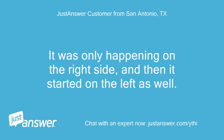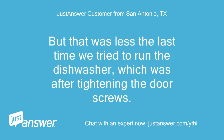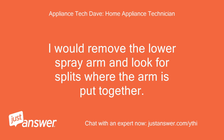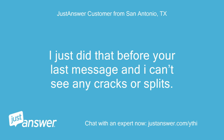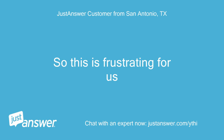It was only happening on the right side, and then it started on the left as well. From what I can tell, the water comes out of both sides at the same time. But that was less the last time we tried to run the dishwasher, which was after tightening the door screws. Then most of the water came out of the bottom. I would remove the lower spray arm and look for splits where the arm is put together. I just did that before your last message and I can't see any cracks or splits. The dishwasher is only 2.5 years old. So this is frustrating for us.